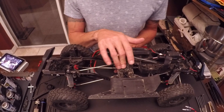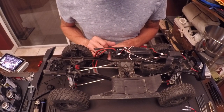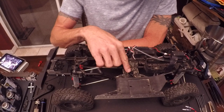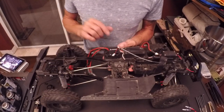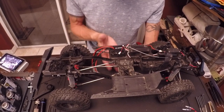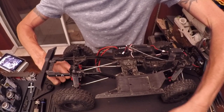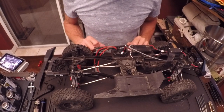So let's walk through where the plan is. First thing is the skid, which we're going to be changing out for an aluminum skid. The reason being, not so much because I want to upgrade it. The mounting holes, as you see here for the AX10, are 4 holes. The mounting holes for the SCX10-2 kit transmission are not the same pattern. So this skid plate will work with this trans. However, it will not work with the kit trans, which has the 2-speed and an option to put a 2-speed in it. So that's what we'll be going with.